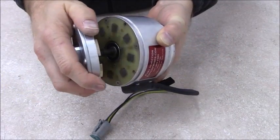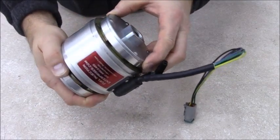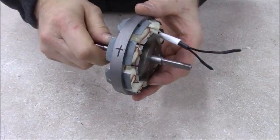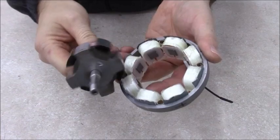Magneto output is generally expressed as primary amperage. The primary side of the ignition refers to what the mag itself generates as it spins. Magnets spinning in close proximity to a stator winding create electrical energy. Incidentally, they create AC energy, or alternating current.